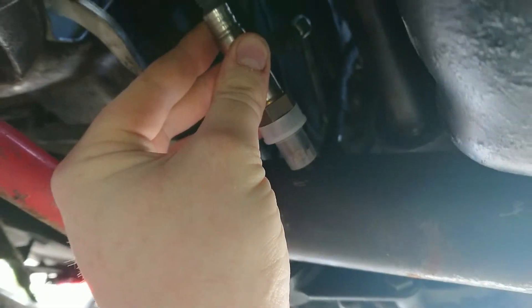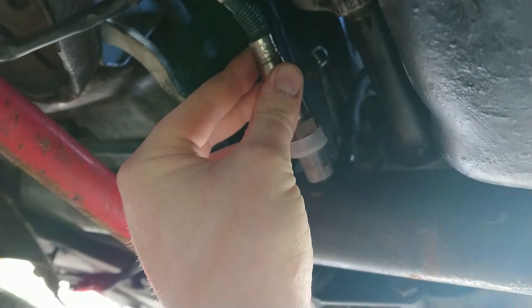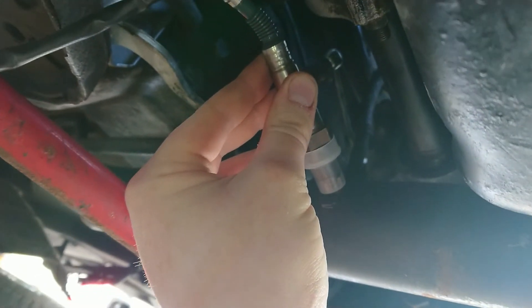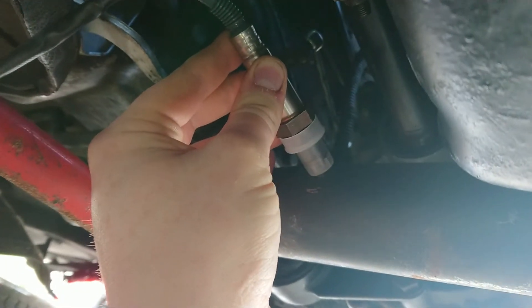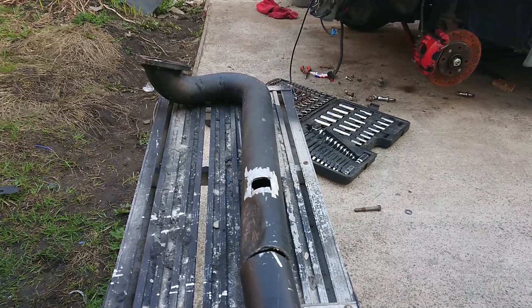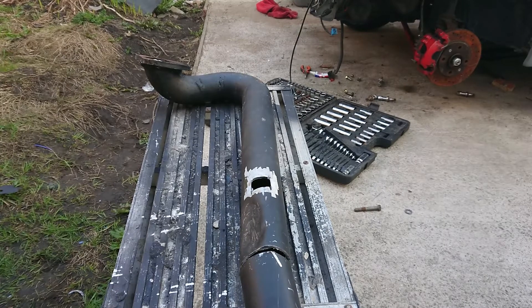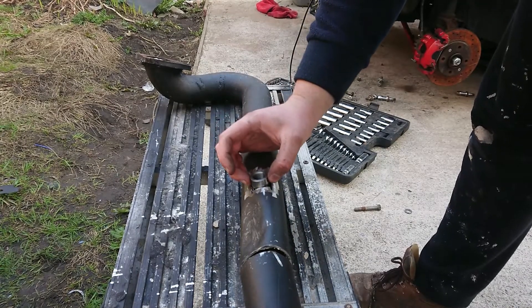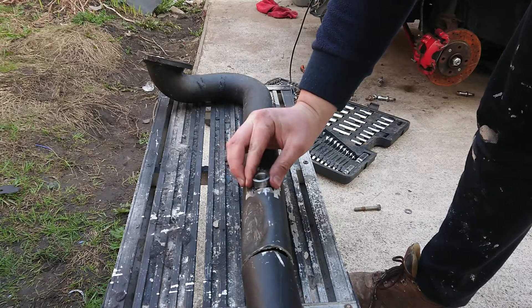The top scratch is where we're going to fit it. I'm just going to get the sensor now to make sure it won't have any clearance issues. Here's the sensor just mocked up — I can see it's going to physically fit where I want it. The reason for the 10-degree angle rather than totally flat is so that any condensation in the exhaust can drain off and doesn't corrode the sensor. You want to drill an 18mm hole where you've marked and then fit your bung. I didn't have an 18mm drill bit, so I just cut a little square and I'm going to fill it with the welder.